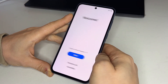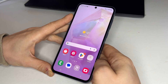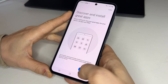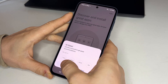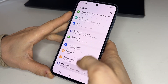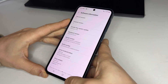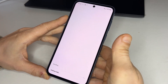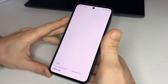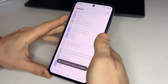When the phone boots up, set it up again. This time it goes further than usual. You'll see that the phone is already unlocked, but we're not quite finished. Wait for setup to complete, pressing later or next as prompted. Next, go to settings, where you'll see the phone is on Android 14 with UI 6.1. The phone may continue showing Knox Configure cannot be used. When this happens, go to settings and manually factory reset the phone. This is the second time we're factory resetting the phone.